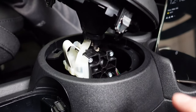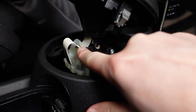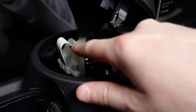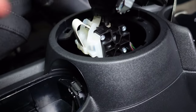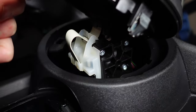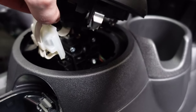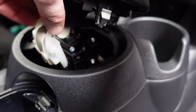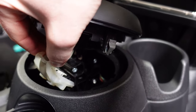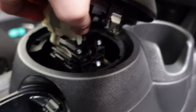With the shifter boot out of the way, the next thing is to get this clip out of the way. Push in on each side, squeeze those together, and then pull up. It takes a bit of prying — squeeze the top two clips really hard together and then pry up, which exposes the connector underneath.